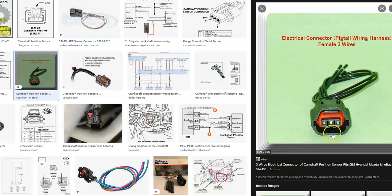With this wiring harness, you'll have one — usually in the middle — that'll be ground. The other one will be a reference voltage going to the battery, so you'll have about 12 volts between those two. The third one will be going back to the onboard computer, to the ECM, to report what's going on with the sensor.